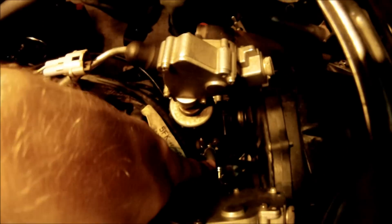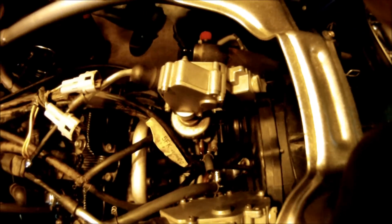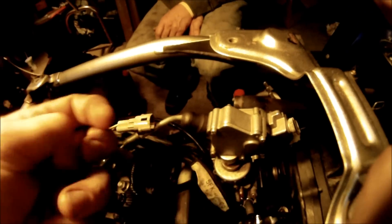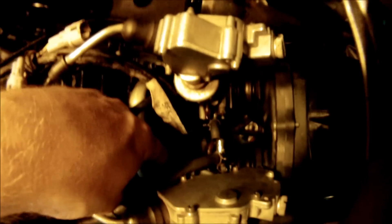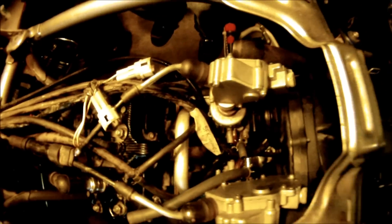Now you're going to want to install your fuel lines and adjust your carbs to make sure they're adjusted the same if you know where they need to be. Don't forget your choke tube install, which goes from right here to right there. Make sure all your wires are grouped together — zip-tie them if you want them to look neat — and they're going to run in between the carburetors, so make sure you install those before you install that second carb.